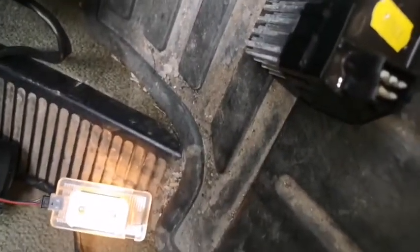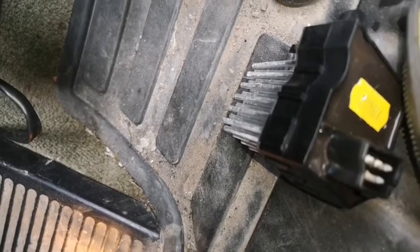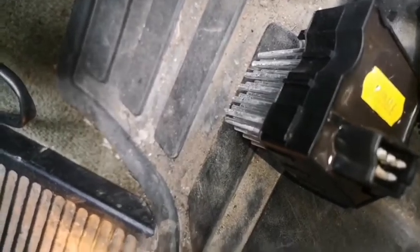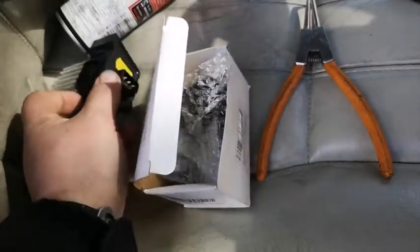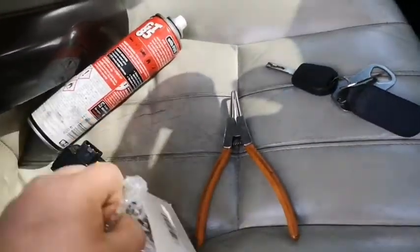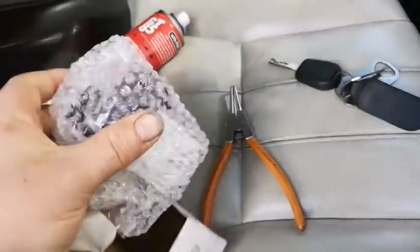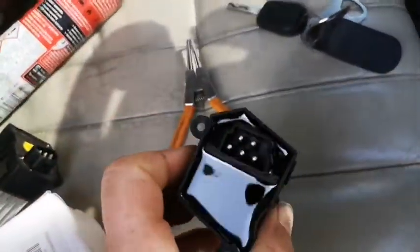I'm going to clean the connector on that, and put it back in and see if it's working. It's because my fans are not doing anything unless I give this a good wobble and it starts working again. So I have actually got a new one. This is not a BMW original part. It's a Chinese one. I tried fitting one of these before. Didn't work, but this is a spare one I've got knocking about, so I thought I might as well give it a go and see if it works. Nice and clean and fresh